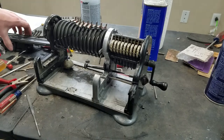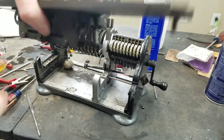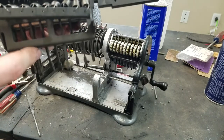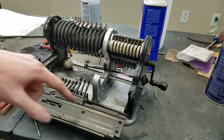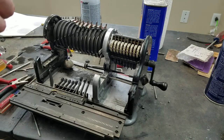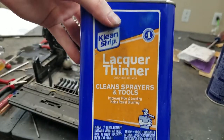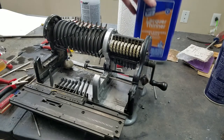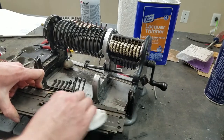I've got these installed here. You can see the bracket there. I just assume that this basically goes on this side — when we actually put it in we can test that and make sure. Hopefully it just slides in like that. But before I put it in, I want to clean this off first. A lot of people ask me what I use for cleaning old grease and stuff off this stuff. I just use lacquer thinner — it's really good at dissolving the grease. You can see how dirty this is.